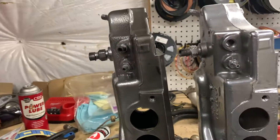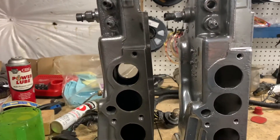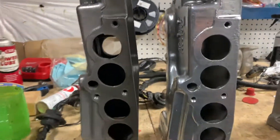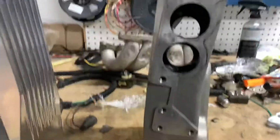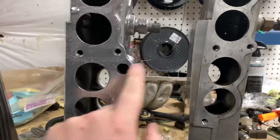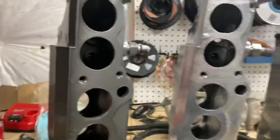The mass airflow setups were pretty much the same from 85 to 88 as far as the intake itself went. The 89s don't have the provision for the cold start injector because they deleted that that year, so they look more like these plenums — there's an EGR port but no cold start port. The 88 was the last year of the cold start injector.